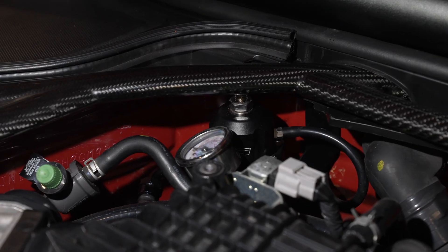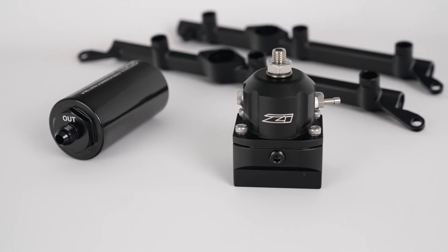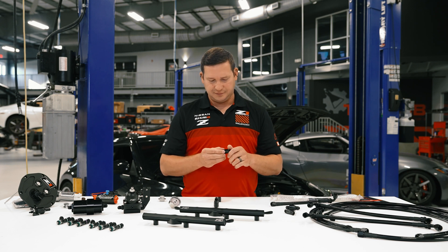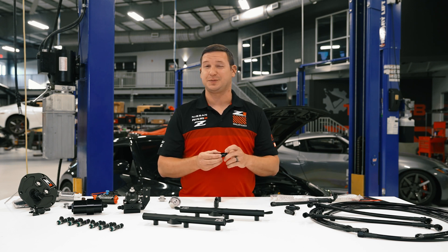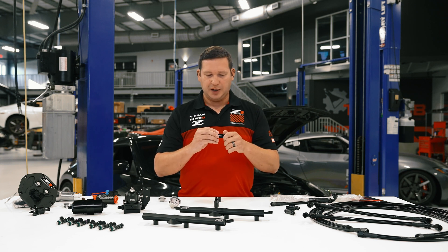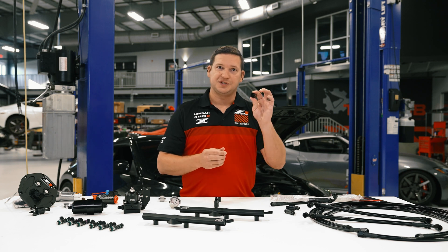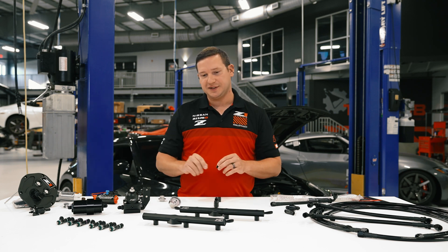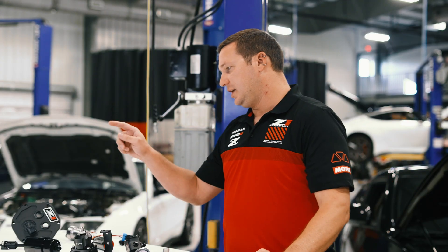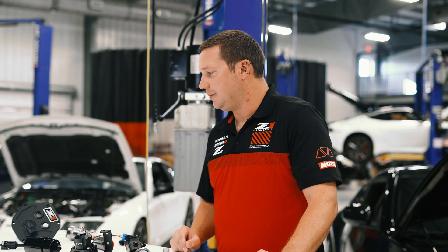Once we come off the rails, we're going to come to our regulator in this scenario, hit it in dual, and tag off of this and run over to one of our hardline adapters. For years we used off-the-shelf stuff probably intended for domestic applications, but our guys have made a more compact version made specifically for your factory feed hose, which will now become your return back to the tank. It's pretty ample size and works great for this. Off the other end, you'll tag in and attach to one of our bulkhead fittings or fittings on top of the fuel pump assembly.